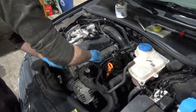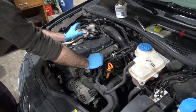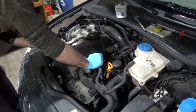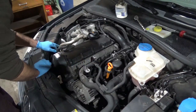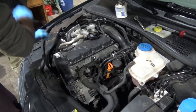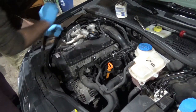Just so you have that sharp blow, right. These are actually a prime example. When I'm dealing with Allen head fasteners, Volkswagen loves to use internal hex socket head cap screws. Especially when one is kind of shitty and has a bunch of crud in it, what I'll always do is get a pick and clean that out, put the socket in, and tap the socket in with a hammer. But when I actually go to loosen it, I go pop, pop, pop.